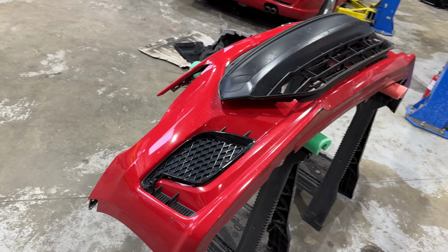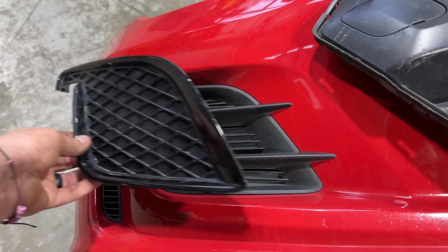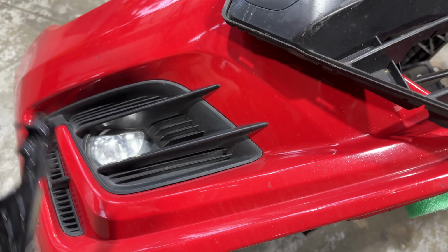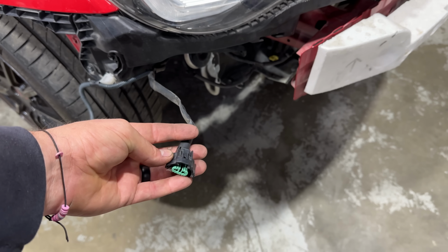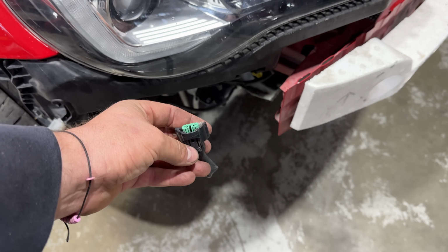The front bumper is really the first spot that we find some differences between the TS and the donor performance pack BRZ. The TSs normally come with these side grills here, which eliminates the fog light. Luckily, even the TSs come pre-wired for these. They're just taped up, and because this is going to see some street use along with the track use, I'm going to go ahead and plug the fog lights in.